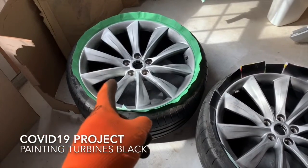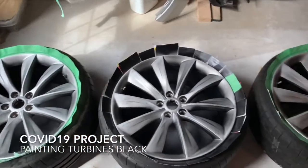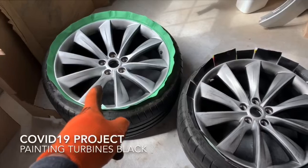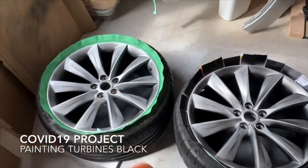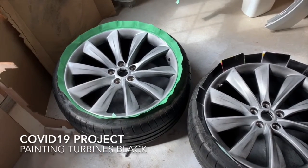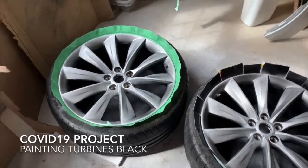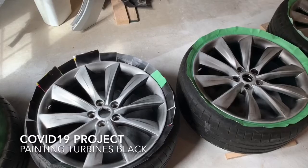So once I finish a light coat here, that's going to take me, let's say, 3 minutes, and about 10 to 15 minutes later I'm going to be back to the very first one and repeat until I finish 3 coats. So I would like to be really careful. I don't want to overspray. Yeah, that's my biggest fear. I don't want to overspray them, because for a couple of those on the back, I found it's already dripping.